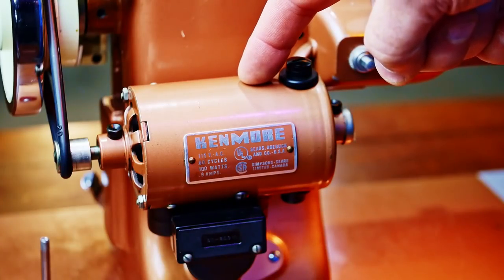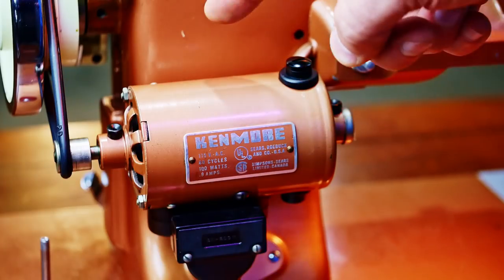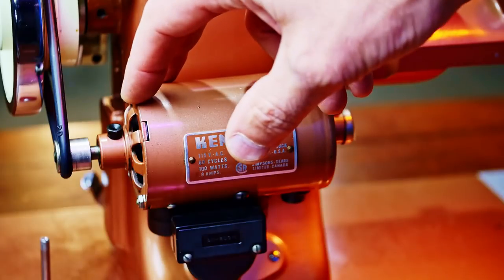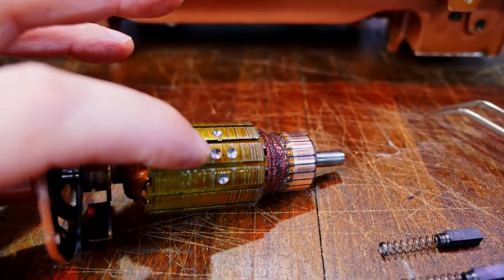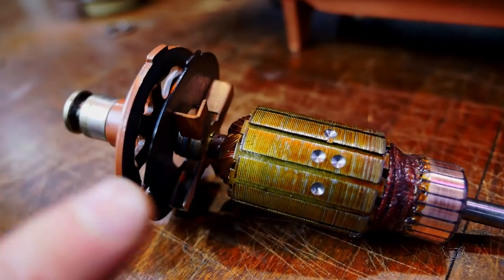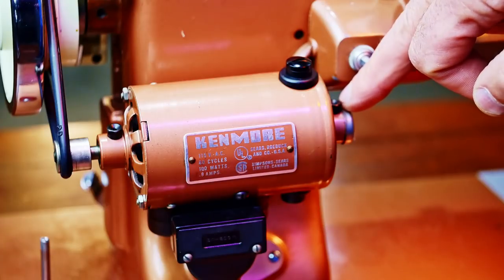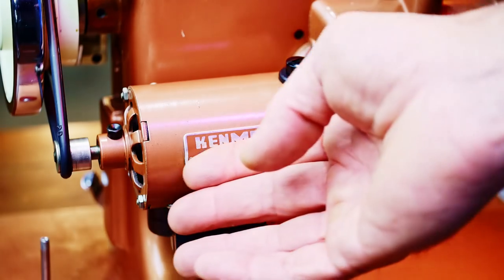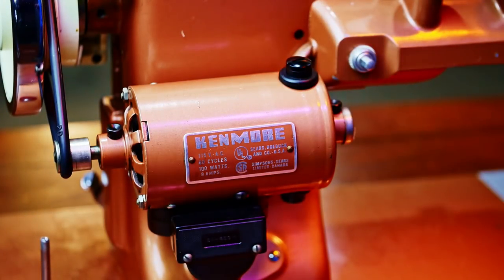I think one of the best parts about this machine is this motor. Of all the antique home sewing machines I've been through, with the exception of the Singer 201, this is probably the best motor I've had a chance to get my hands on. I've had this motor apart — it's built very well. New motors, I don't think, will have these drill spots where they drill out some material to balance the motor. This old motor is balanced and has a fan to keep itself cool. This motor to me seems as good as the day it was made. I like that it has oiling ports on the bushings. You sure don't want to over-oil them — you'll get oil inside the motor, which you don't want. One drop of oil there and one drop of oil there, and those bushings will be lubricated for a good long time.